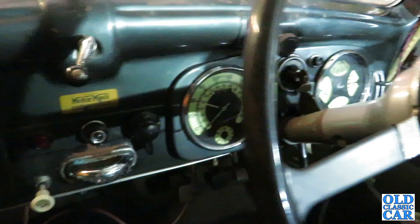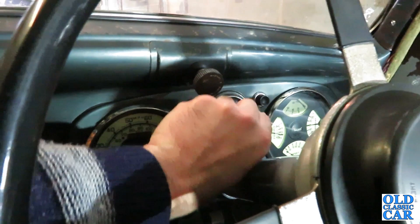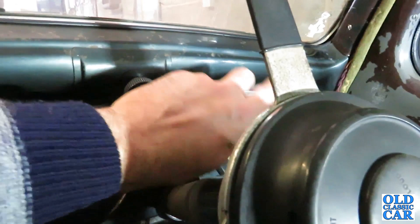The first thing I'm going to do is see if there's any signs of oil pressure. There is oil in the engine, but if there's no sign of oil pressure on the gauge then any thoughts of trying to fire up the engine are probably out of the window. So first thing to do: hang the battery on, spin her over with the plugs out, and just see if there's any oil pressure registering on the gauge - the top of the four in this cluster here.